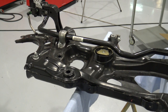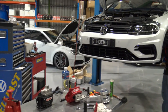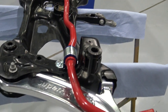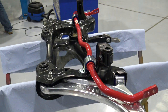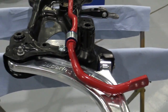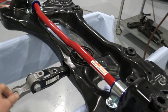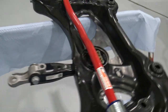I'll take another short video once we've replaced all of those with the new components, just to give you an idea of how it all looks. Now you'll see our installation is well underway. Here are our control arms and our sway bar in place. You'll notice the action on the sway bar now is just like a bearing, and same with our control arms. This helps us enormously when we set the suspension up and corner weight the car. And you'll see we now have the upgraded Dogbone Mount in, which will reduce the amount of play in that unit as well.